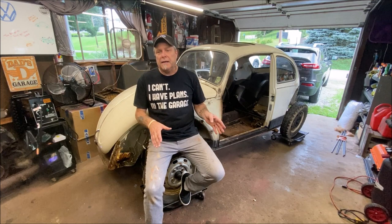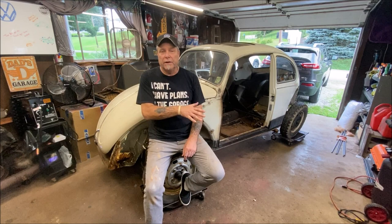Today we're moving the axle beam off the front — of course the brake drums, the backing plates, we're stripping all that out. I've already got the gas tank disconnected because you've seen that in an earlier video. We've got to pull the front beam. We're going to start stripping this car completely down. We've got the dash pad off and now it's time to get real.